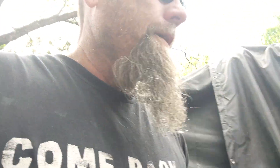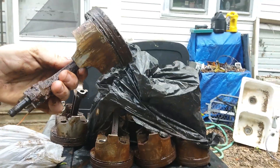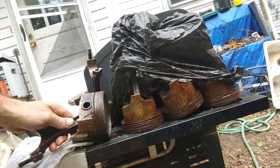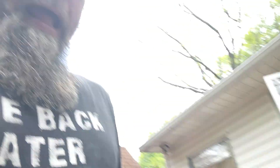So if your car is smoking, what happens is you'll have wear on the inside of those cylinders or you'll have scratches and oil is getting past your rings. These are your rings on here, and as you can see, all these rings are locked tight up. There are three or four rings on this piston — you got an oil ring and you got scraper rings. What happens is oil gets past those rings and it makes your engine smoke.